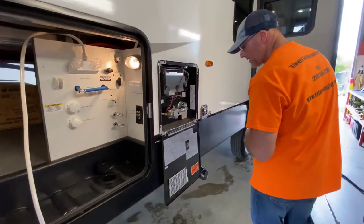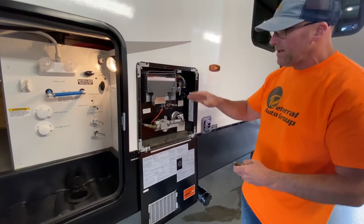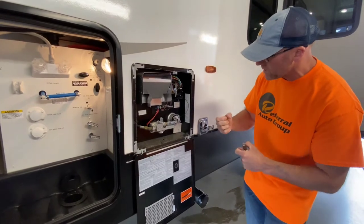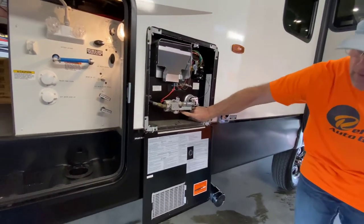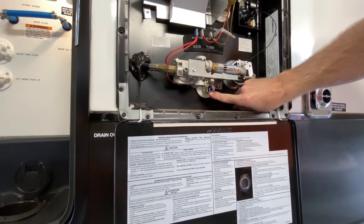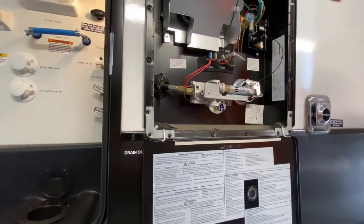This is your water heater. It is 10 gallons of capacity. It is gas and electric, which we'll see in there. Your water heater has no anode rod. That's the rod that takes all the impurities out of the water. This is a cladded tank, so you just have your Teflon plug right here. Eventually, after you drain your tank and maintenance this thing a few times, you'll probably want to put a brass plug in there, but just make sure not to crank it down too much.